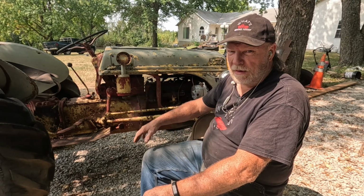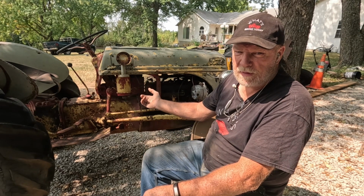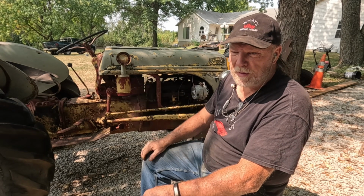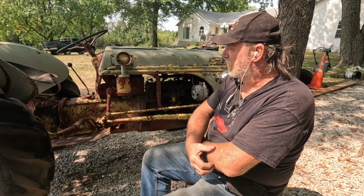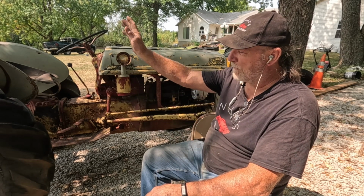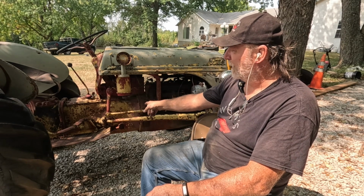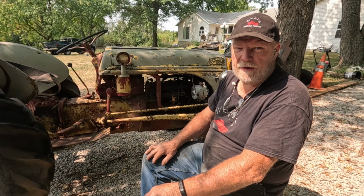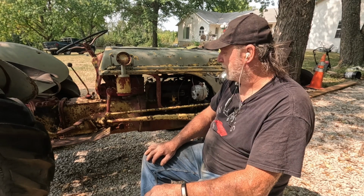It started out, I only had, I guess it'd be second and fourth gears. After it warmed up a little, then it loosened up and first and third started working. Ran the hydraulics up and down. They did okay. Now it does need the fluid in the transmission and rear end changed, because I think it's kind of milky looking, got some water in it.